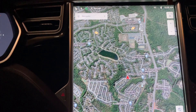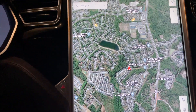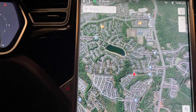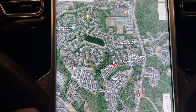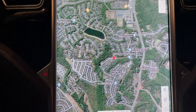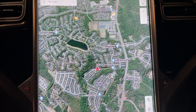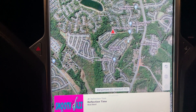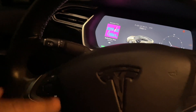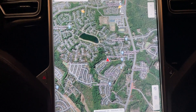I've had this car since 2015, close to six years now. Have I really detected a problem with my main control unit? It's beginning to show a little chinks in the armor. Internet in this car is absolutely null and void — it's not happening. If you touch the internet symbol, it will just show you a white screen and it will spin. If you try to get information from the owner's manual, basically the same thing. You can do a hard or soft reset by depressing the buttons on the steering wheel, and eventually it will come up and you can read some of the information, but it is terribly slow.